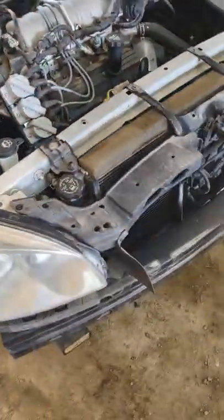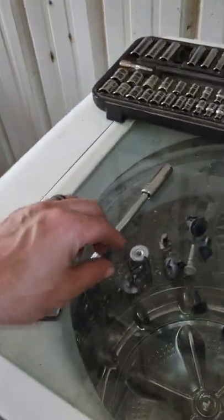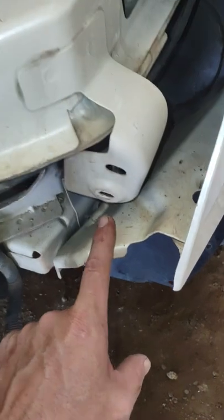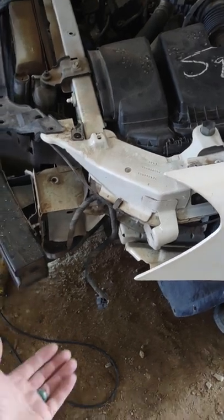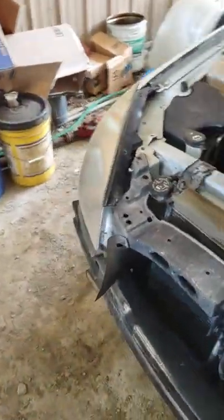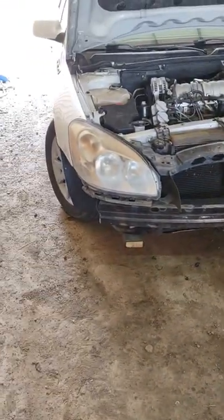We have a lot more work to do, but at least you can see we got the front of it off. There is a screw nut that is underneath the corner pocket in this little spot right here. You can go through over here and up underneath to see that screw — it is a real pain. If you're just changing the headlights you can go underneath where the plastic piece is, but if you're changing the whole thing you'll have to take pretty much the whole front of the car apart and take the mud flaps off too. Other than that, thanks for watching and have a good day.